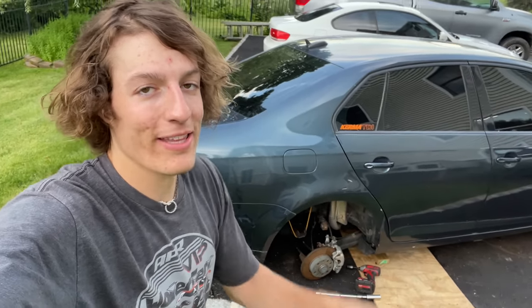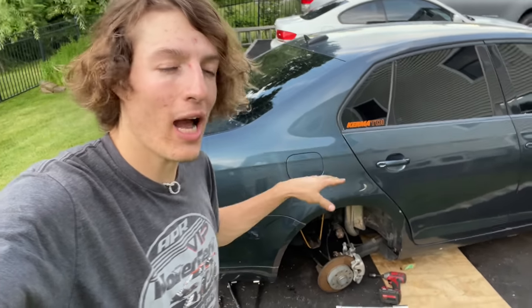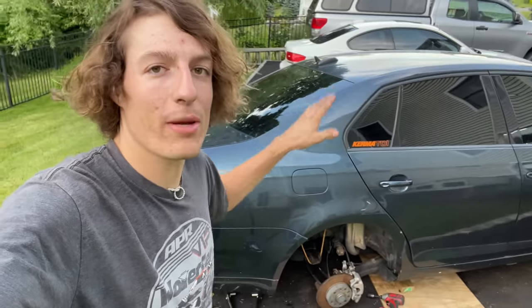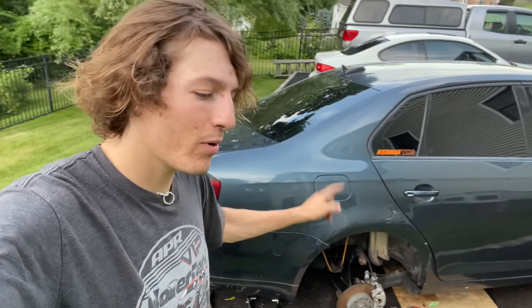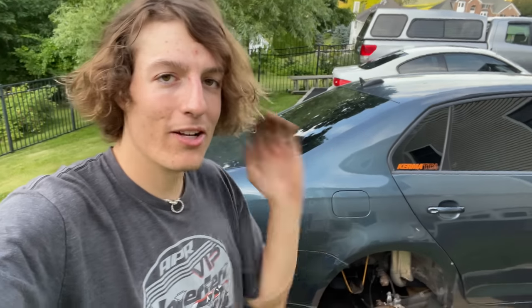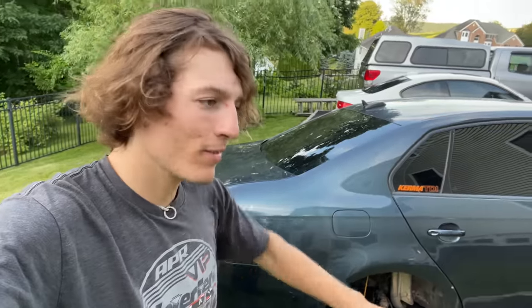Now, although this has been a struggle, it's nothing like it was the first time I did it, like 6 years ago, back in like 2016. I just jumped underneath the car, tried taking all the nuts and bolts off, had no guidance, and the thing was rusted. So what I did the other day was I sprayed all the bolts down with WD-40, all these came off, and this one last bolt, I left it to be the last one on this control arm, because that bolt, every single time, gets seized. The nut comes off, but the inside by the threads, inside of the bushing, gets seized.